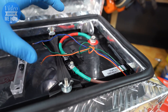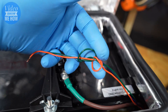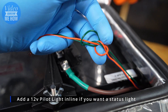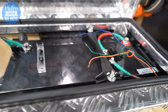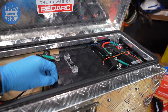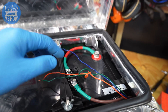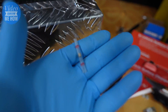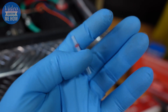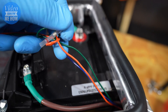Making really good progress — we're on the home stretch for wiring everything up. These two wires — green and orange — define what kind of charge profile we want our BCDC to charge the battery with. Because we're running the lithium battery, what we need to do with these is basically just join them together. There's a full video on the channel showing the best ways to join wires. We're going to use one of these little doodads — a solder and heat shrink in one — to join both of these guys together.